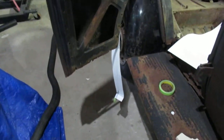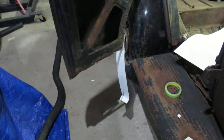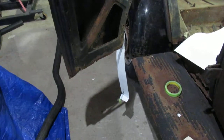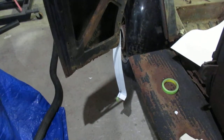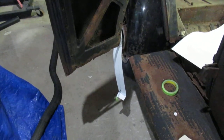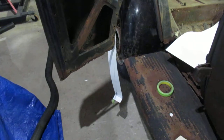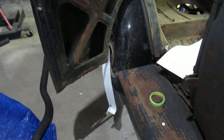That's kind of where I'm at now. I want to fit the rear door skins but I can't fit them until I have a door bottom on the inner so I have something to tap them against. Hopefully in the next little while I can do the inners. The forming dies from Eastwood are at the post office in the States — I've got to go pick those up, hopefully next week. I'm going to be out of town for work quite a bit, plus we had a large transformer issue to figure out as well. Thanks for watching — I'm going to focus on these doors until I'm happy with them, then move on to another job after that.